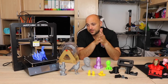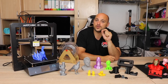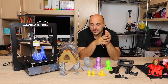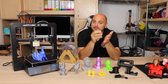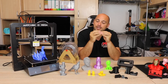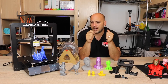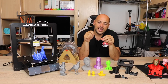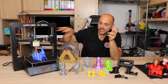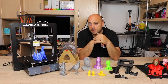There are a few important things to mention about this printer, and one of them could be very frustrating. The hotend fan — which cools the heatsink fins — was underpowered on the machine I received. It wasn't cooling quickly enough and I was getting a lot of jams and clicking due to heat creep. After a jam, I took out the PTFE tube and it was really hot. After disassembling the hotend I found the fan was barely moving, so I had to replace it with one of my own spare fans.